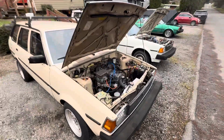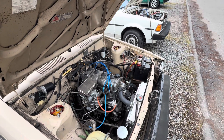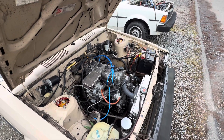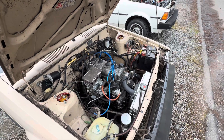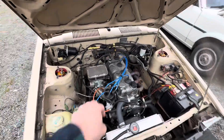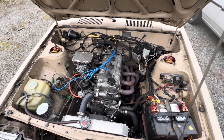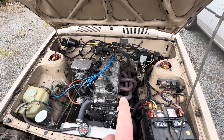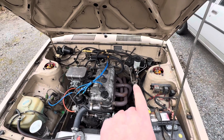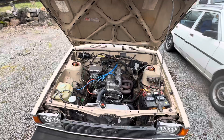We're gonna start here — this is a 1982 Toyota Corolla station wagon. It has under the hood a completely stock 12T. Yes, that's right, 12T — it's basically a 2TC with domed pistons and a different head and combustion chamber, that's the major difference. Stock cam, everything's all stock except for a 32/36 Weber, a tiny amount of porting on the cylinder head — I knocked the EGR humps down, nothing big.